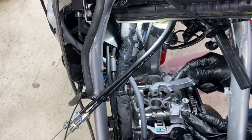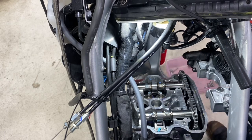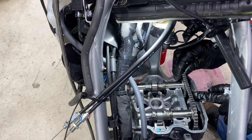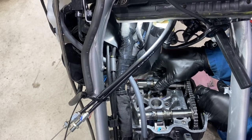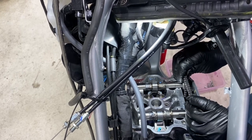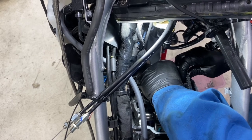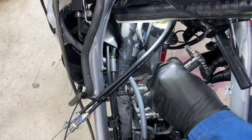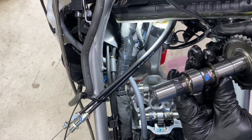So let's keep pulling it apart. We've already undone our cam bridges on both sides. To this point it's fairly simple — just timed up on the timing marks on the side of the engine. We'll pull the exhaust camshaft out. I've taken the tensioner out already. There we go — we'll just take the one out for now and let that rest there. So that's the exhaust camshaft out of a standard CRF 300L.